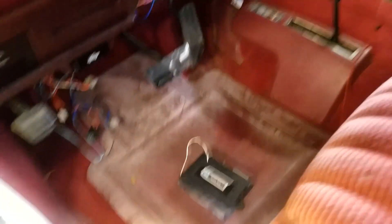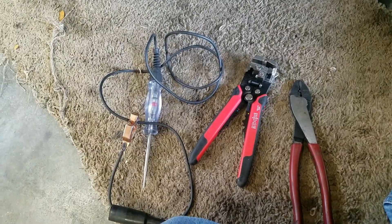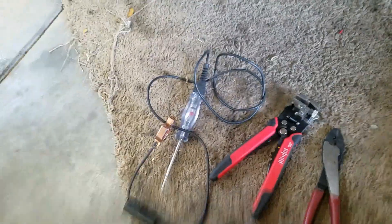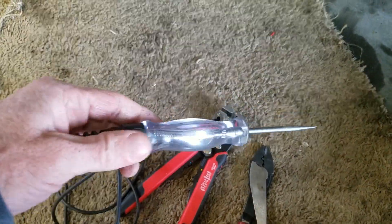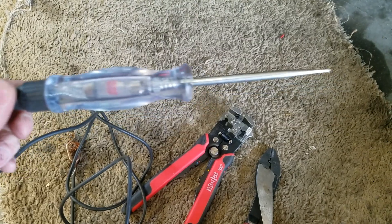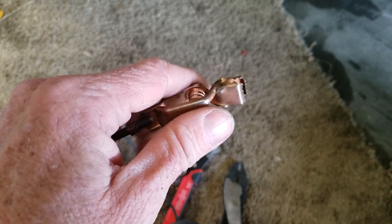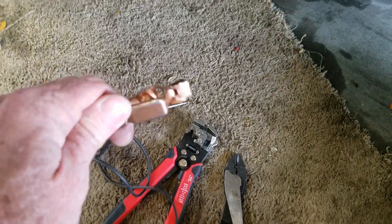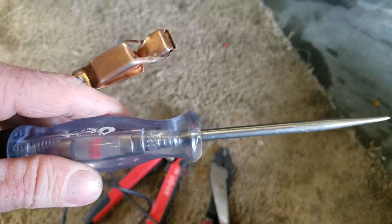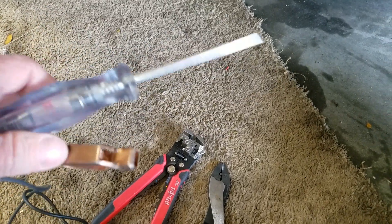That's what we're going to do today. The first thing we need to start with is tools for electrical diagnosis and repair. You cannot live without a test light. Your typical test light has a little light bulb inside of it — the pointy end stabs your finger and the clamp side you clamp onto a negative side, which is always the most difficult — finding a good clean ground to clamp on. Then you poke around with the pointy end until the light comes on, to know where your circuit breaks and where you have electricity flow.